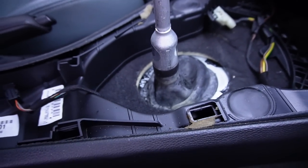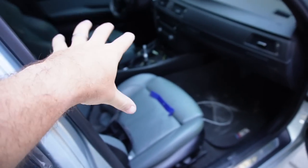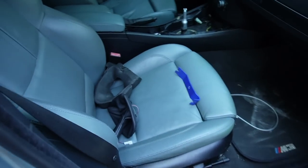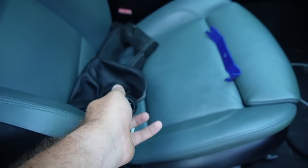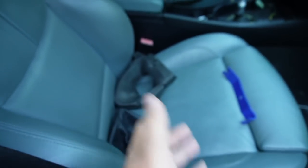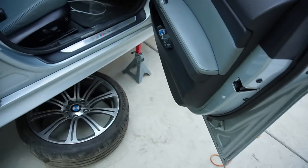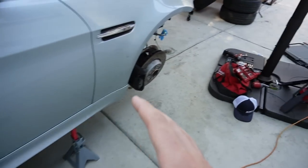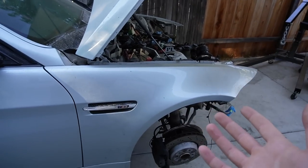Because this is a manual, I think it does just drop directly through. It's actually my first time removing a manual transmission — normally I do manual swaps. It looks like there's literally nothing in the way. Went ahead and removed the two other things that were in the way. We can transfer those over to the e91 as well. At this point, let's disconnect the drive shaft, which should leave us with just a few more little things before we can drop the engine.